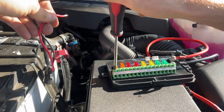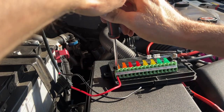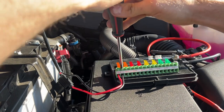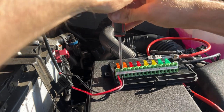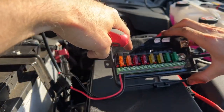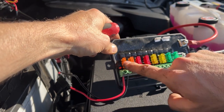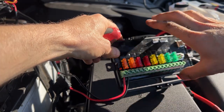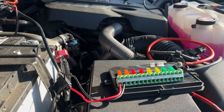So I'm going to open up the first fuse — this is a very small Phillips head that you need. Nice and tight. And then same with the negative — tighten down the negative. My hand was blocking that first shot, my bad. So the cube lights are in the first five-amp fuse. According to the instructions, you can switch around these fuses — you don't have to leave a five-amp in there or a 30 over here; you can swap them around, but that's how much power will be allowed to circuit through. My two cube lights draw less than five amps, so we're good there.